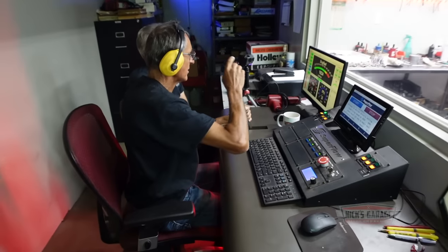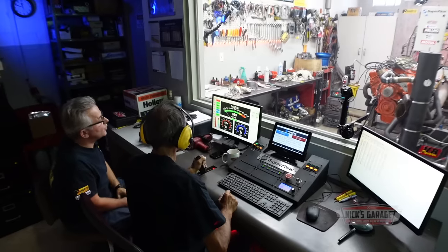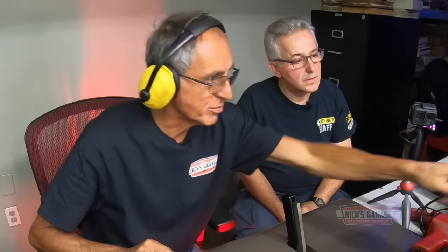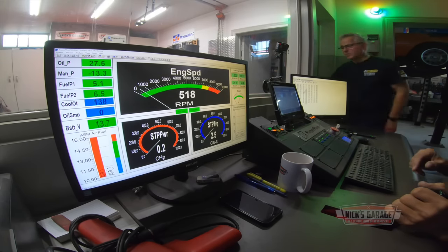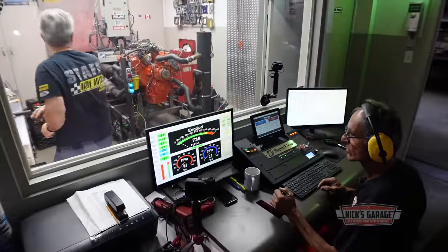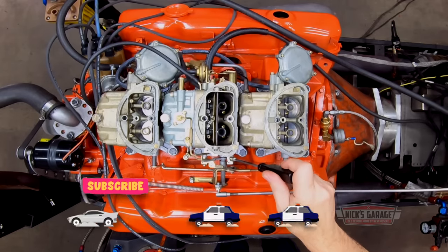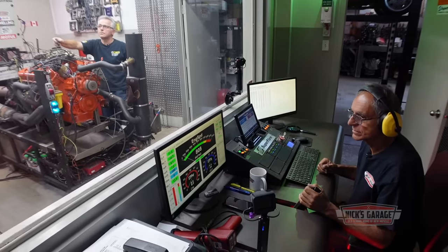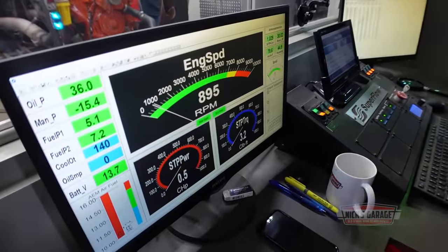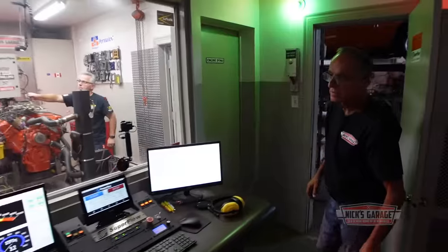The water's at 135, eh? See the oil pressure? But you're at 500, your idle is way low. Very lean on idle, eh? I want to bring the water temperature up. Look at the idle, it's very low. Manny, you want to bring it up a little bit for me? Bring it to like 950, 1,000. Idle is unusual. It's giving Nick cause for suspicion.